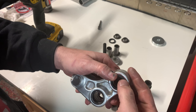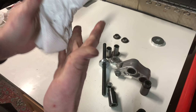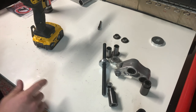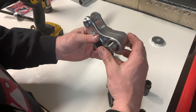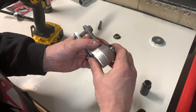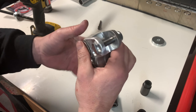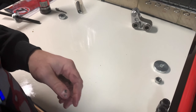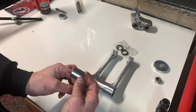I like to put some grease where the seal's going to go because it makes the seal go in so much easier. Put a little grease right there, and then we'll wipe this grease off once we get our seals in. That's a tremendous amount of grease — may not be necessary to put that much. Push them with your fingers — you can do it, you're strong. There we go — letters out, remember. Seals in, easy day. I think in the book it shows the long side in first, but it really doesn't matter. That way your stupid needle bearings stay where they're supposed to go.